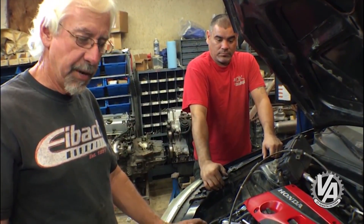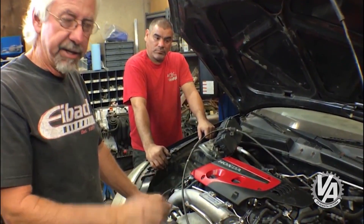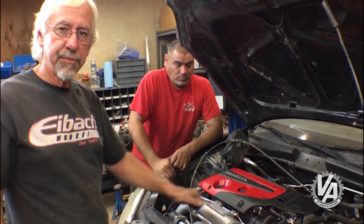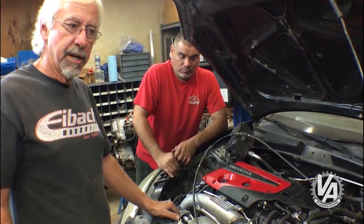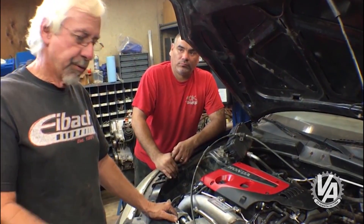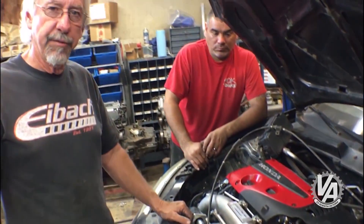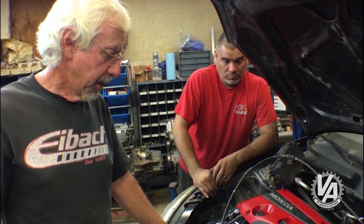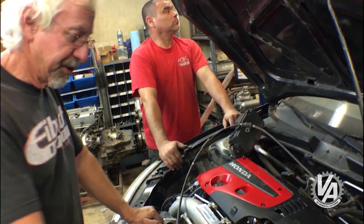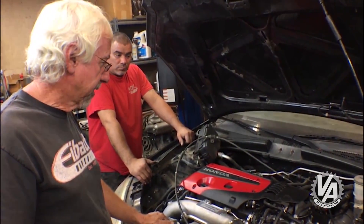We need to do a little more work on this. One idea I've been toying with — you may have seen me mention it in another video — is to make an adapter plate so you can use a stock K-Series transmission, like the earlier model ones from the RSX, with this engine. There's going to be a pile of these motors available from Accords, because the Accord is going to come mostly with a 10-speed automatic. If you're like me, you don't want an automatic and you'll want to use some sort of K-Series transmission. I think an adapter plate would help out tremendously with swap availability. I'm happy to say it fits in this chassis as well. I actually have an RSX we're going to be pulling the motor out of pretty soon, so I'll double-check it on that. So far, so good.